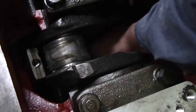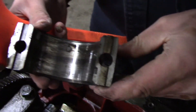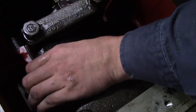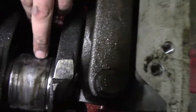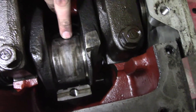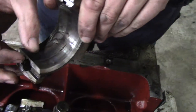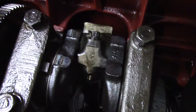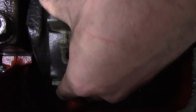Yeah it does - it's spun though. Spun the back of it. You can see where it marked - not bad. I'm gonna say this piston is... I don't think that's the one that locked it out. The bearing did spin. Oh yeah, that's where it lines up - it turned. It grabbed it there but it really didn't chew up the rod - gave it a little heat spot. That's the bad one, this is the one that was snug. I've never seen that - these are grooved, you can't put them on backwards. That's strong stuff.